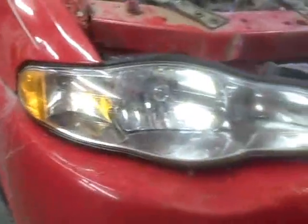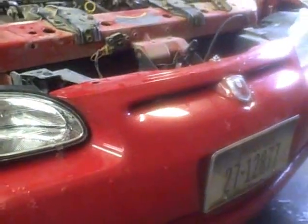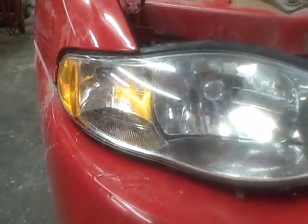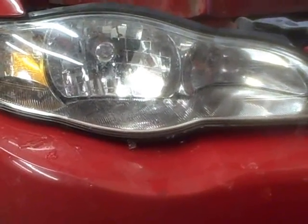It's definitely not perfect, but it's about as good as it's going to get with the mucked up bumper pad. The headlight is no longer shoved back behind the fender and no longer pointed up, but it's not perfect. What I ended up doing is taking a screw right back in there and actually screwing it to the bumper pad, because I couldn't get the bumper to come down enough to keep from pushing that headlight up, and the headlight supports aren't rigid enough to hold the headlight down. So I'll have to talk to him about getting a bumper in and some paint and see about getting the whole front end fixed back.